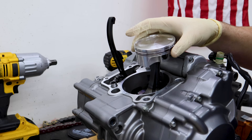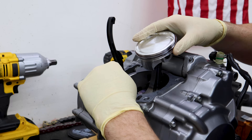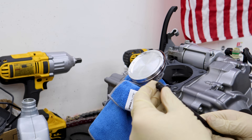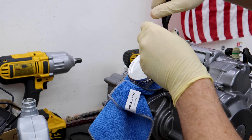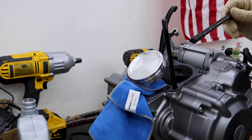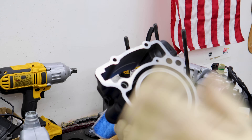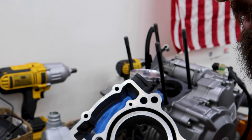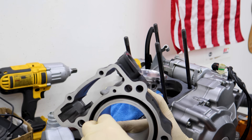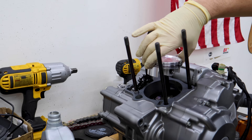Let's slip on the new base gasket. Now I'll install the studs — I'll take a small dab of oil on the threads. You don't want to glob oil on there because it can hydraulically lock things, but a light residue helps you get proper torque. The thicker threaded part goes in the bottom. I grabbed the cylinder, gave it a big blast with the air compressor to clear any bits, then made a little slurry of assembly lube and motor oil, fingering it all around the bore so it's fully coated.